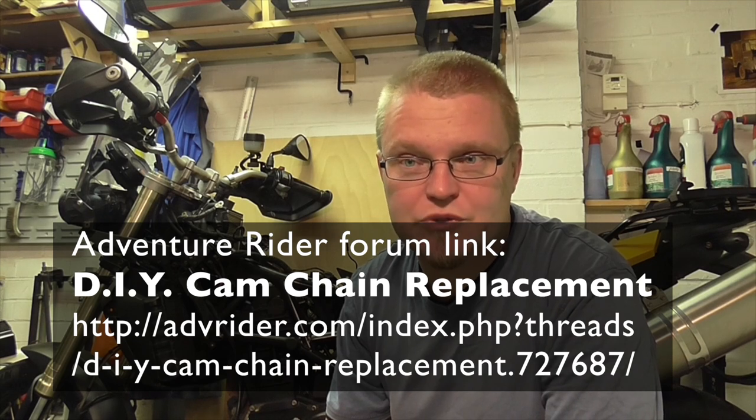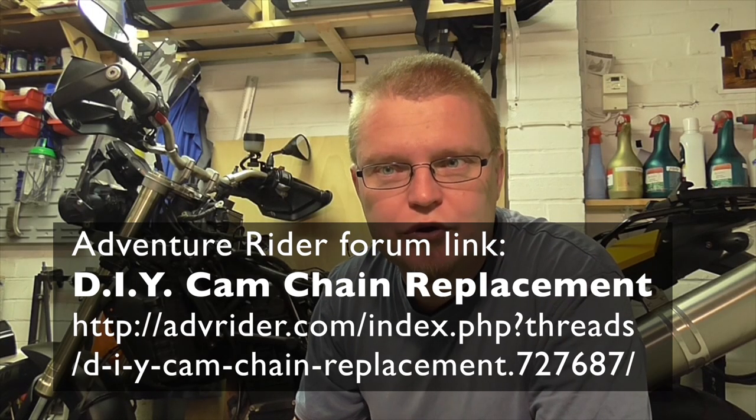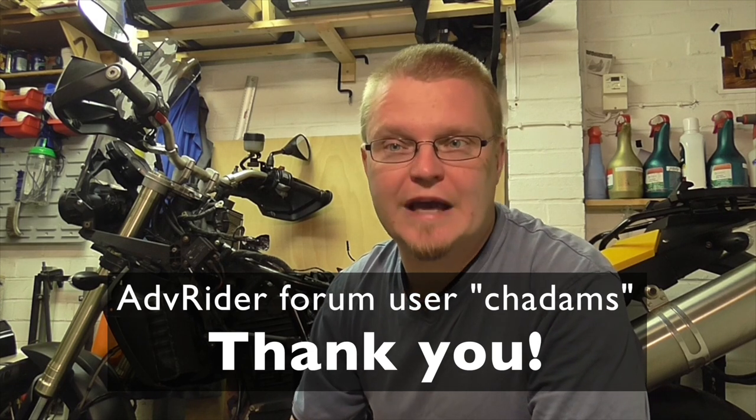So I went onto the internet and searched the Adventure Rider website forum, and found that this can happen. The BMW way of doing this is to take the engine out of the frame, split the cases, and replace the cam chain. It is also the way that it's described in this one. However, some clever chap found that you can get a split link or a master link for the cam chain. This means that there's a possibility to break the old chain, put the new one on, push it through, and then connect the new chain.